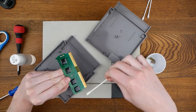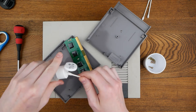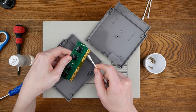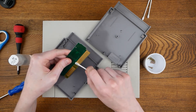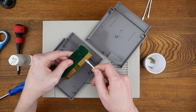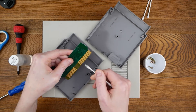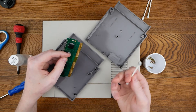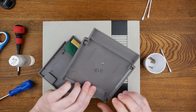I was able to just run the Q-tip back and forth — and these actually look a little dirty, so maybe they could be cleaner. Just squeeze some rubbing alcohol out onto there and go over them. Yeah, look at that — picking up some black grime. You want to use rubbing alcohol instead of blowing on the contacts, because your saliva is acidic and that is going to cause corrosion. I cleaned this probably two or three times with rubbing alcohol and a Q-tip, and I'm still getting disgusting grime off. Do it several times on the cartridges until it stops being disgustingly black — this is what is preventing the cartridge from making contact with the 72-pin connector.